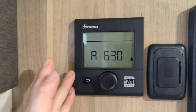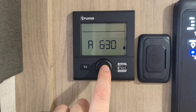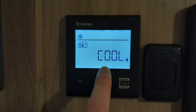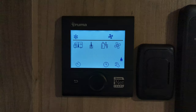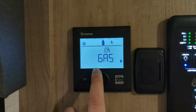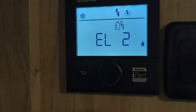This is going to be your Truma — basically a three-in-one system. You've got your Truma Combi water heater and furnace, and the Truma Aventa air conditioner, and this can all run off your solar. The left camper symbol button is whether you're on heat or AC. Go to AC, turn it to cool, set your temp, go all the way over, set your fan speed, and it kicks on. The middle button controls whether you're running on gas, a mixture of gas and electric, more electric with still some gas, or just electric — electric low on electric one and electric high on electric two. This middle one here is your water heater control. You tap it, and you've got eco, hot, or boost, which gets it as hot as it can as quickly as it can. Whenever you make a selection, you have to tap again to confirm it.